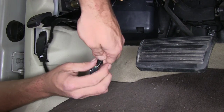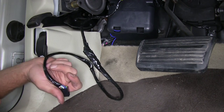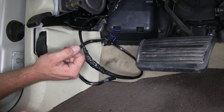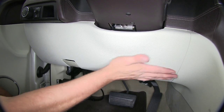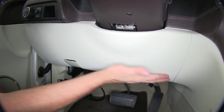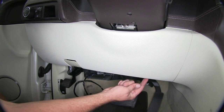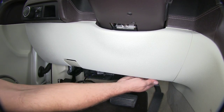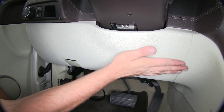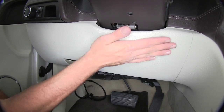With that wrapped up, that will give us a nice clean wiring look so we won't have four separate wires hanging out. We're just going to set that aside and get our brake controller put in. Now we can mount our brake controller — we can pick really any spot here on or under the dash that we like. I like to use this small screw that's right here; there's already a hole there and it goes into a metal bracket, which is going to give us a lot of support. You can also mount up on the dash as long as you stay within the angle limitations.